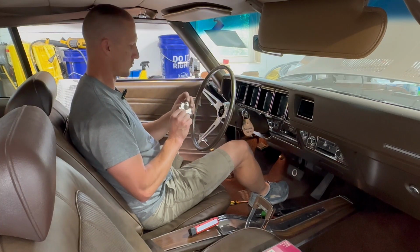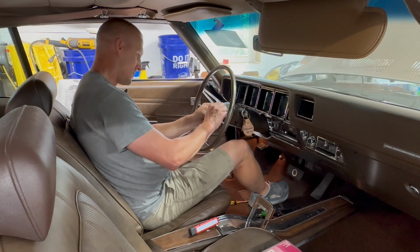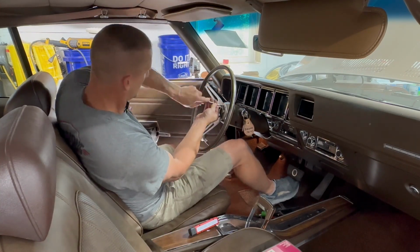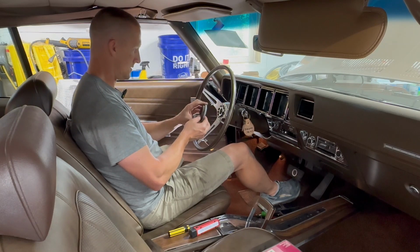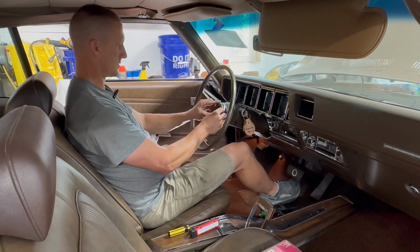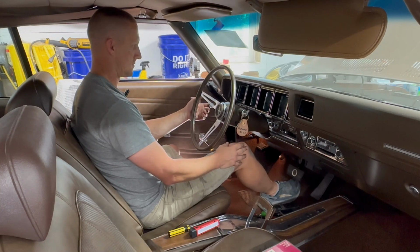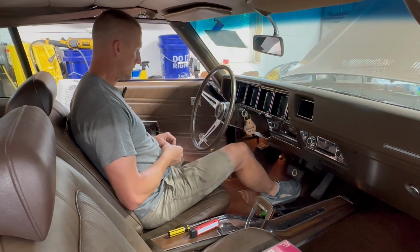This little tang on these sport wheel horn buttons has to hit that tang on the horn contact inside the wheel. And the horn button, in theory, can go on any way, but there are these little reliefs for all these screws. And it's kind of hard to screw it up because, there we go. Perfect. All right, nice and centered. Good to go. Cool. So that's how you replace a turn signal switch. What else have I got to do on this thing?